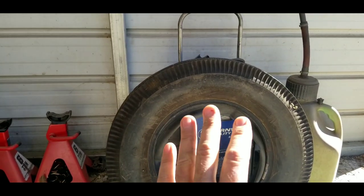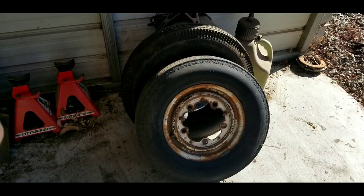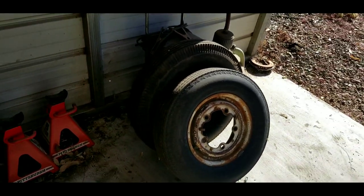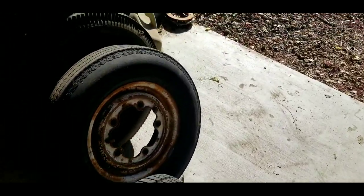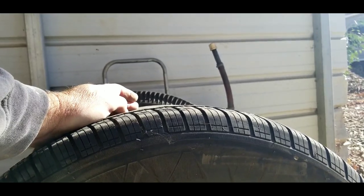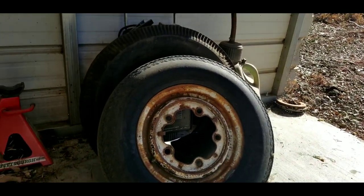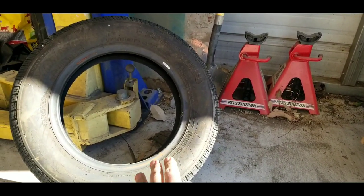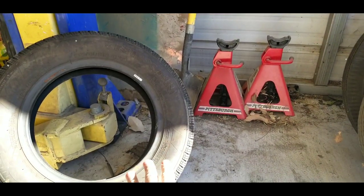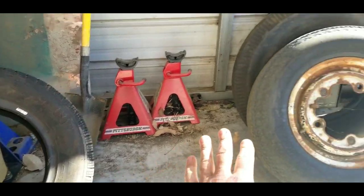The big nut was for the 14-inch tire and it was 1.26 to 1. This is an original bias ply spare tire, and I believe it's actually the correct size — let's compare it to the 165/15. The 165/15 is about the same size, maybe just a little bit smaller, but not much. That's why I say to run the 205/75/14, because according to the tire size charts it's about an inch taller. The 165/15 is supposed to be the same height as the 185/14 as far as the tire chart goes.